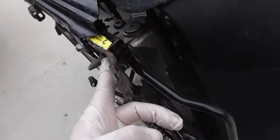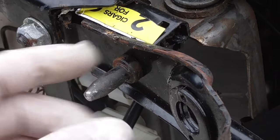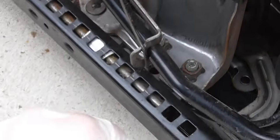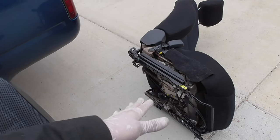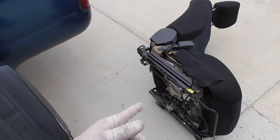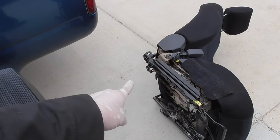These pins right here are going to have to be cut — not the whole thing, but right where this flat is. Don't cut the whole thing off because this is like a rivet that mounts the bracket on. So just cut it off right here on both sides and on both seats. I'm going to cut those first, then come back, set it in the vehicle, show about how far they need to be bent. I'll bolt the front one in, find where that other hole is, puncture the carpet, cut the carpet around it, and just stick a bolt in it so it will stay. Then I'll show you what I'm going to do with the rear.